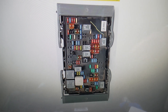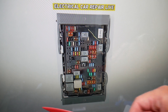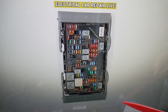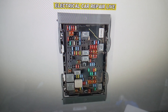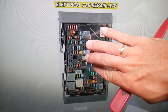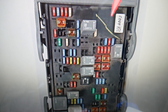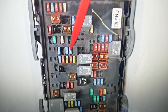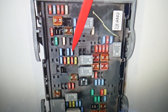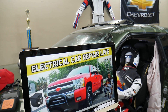The transmission torque converter solenoid is listed under a different name. If you look at that fuse box, let's explain the layout: this side is towards the front of your Chevy Silverado, this is the windshield side, passenger side, driver side — so you know where we are working. The fuse you're looking for for the torque converter solenoid is known as fuse number 19 — we're talking about this 15 amp fuse here. You have other transmission fuses as well, and we have videos on the channel for those, but fuse 19 is specifically for the torque converter solenoid. If you have any questions, don't hesitate to let us know. Thank you guys for watching — see you next time.